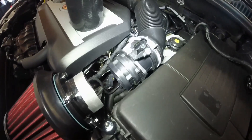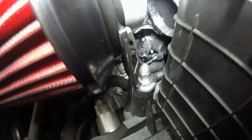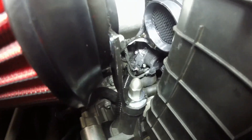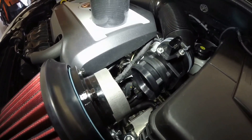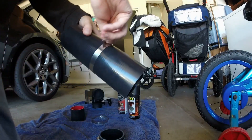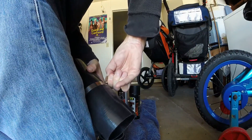So all we're talking about here is just your MAF and your stock stage 2 intake pipe. A little bracket down here — a 90-degree bracket right on your same rubber isolator — and you're just gonna find the hose that fits right into that spot. That's a really simple intake. The silicone hose is really easy to cut just with a razor blade; it almost goes through like butter. You just move it a little bit and it just slices right through.